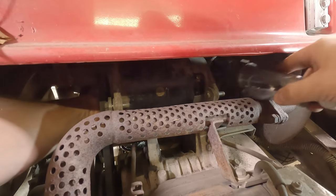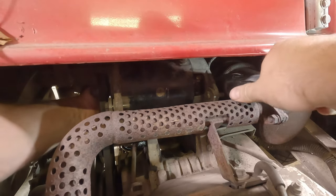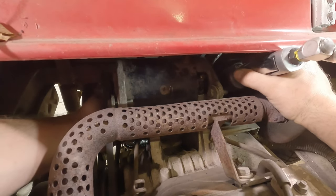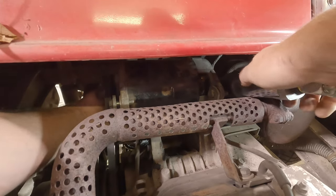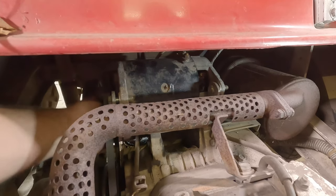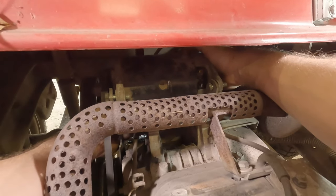I'm going to leave the bolt in and just take the nut off so I don't lose the washers — even though they're pretty much shot. Now I need the half-inch on a long extension. I have to guide it in here — the problem is you have to fight with the lack of space. We're undoing the adjuster bolt and nut, half inch, and then the starter generator should become loose.